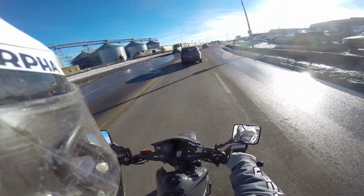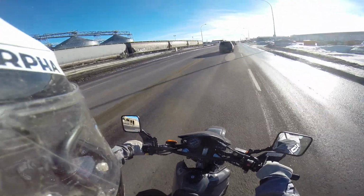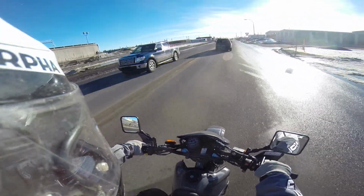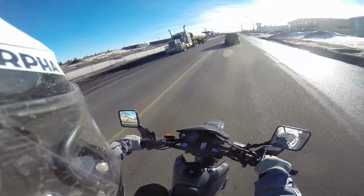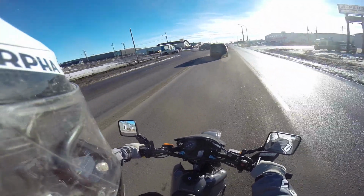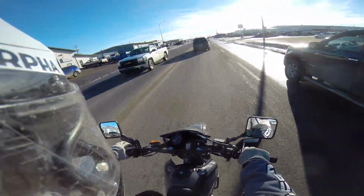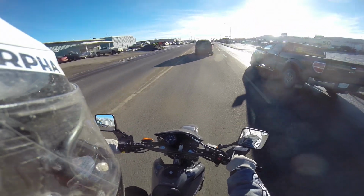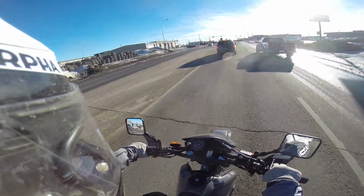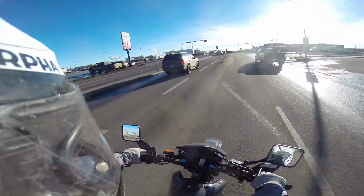Remember, you're breaking it in: ride it like you stole it. The only thing I find wrong about that is I see guys practicing their wheelies and really taking the bikes right up to high revs, shooting it up to as fast as the bikes will go, redlining it. That's probably fine for the engine. I've done that. I've broken in a couple bikes that way, and it's great for the engine. But what it's not as great for is your gears, your sprockets, your chain. All that stuff has to stretch in nice and normally too. If you're going to be doing that, you're going to be reducing your tooth life on your gears, especially if that's not how you normally ride. If it is how you normally ride, I'm sure you can afford it, you're going to go through tires and everything else. But that's why I don't ride it like I stole it necessarily.